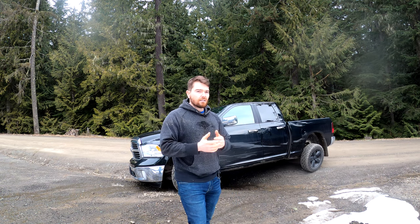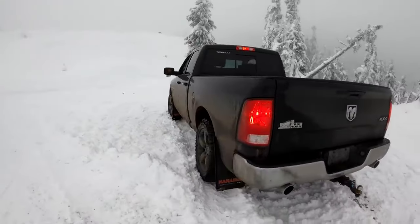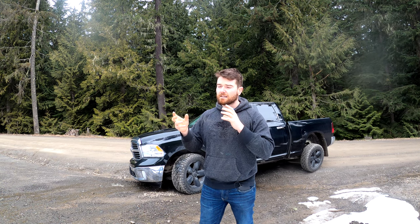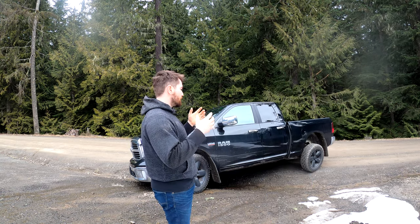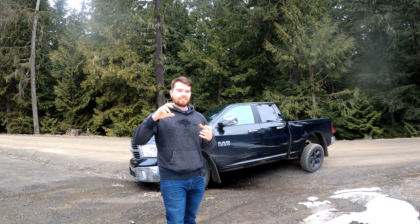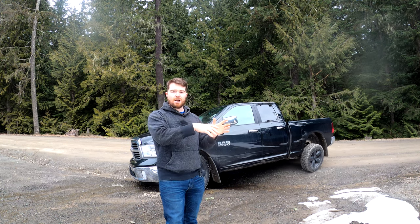The main reason we're here is because I did a video about hydraulic lockers — basically applying brake pressure to try and lock up your open differentials, hopefully getting both wheels to spin. I did that up at Mount Washington and was unsuccessful. But I keep seeing videos online of Jeeps in four-wheel drive having success with applying some brake pressure and popping out of situations where open differentials aren't up to the task. I wanted to revisit that in this high-center situation, and see if applying brake pressure can distribute power to both wheels.